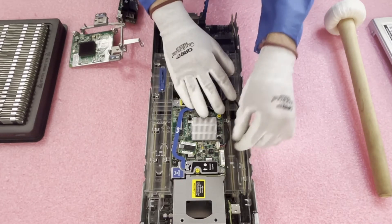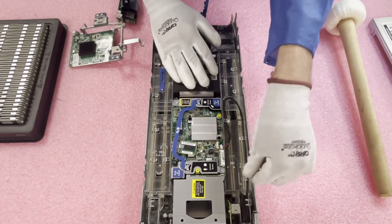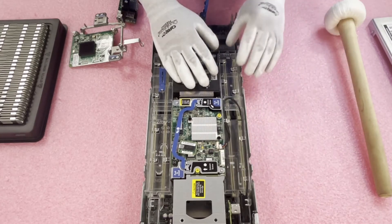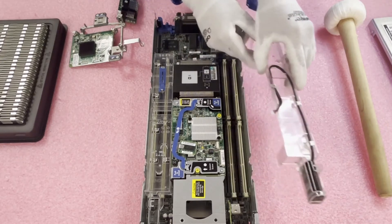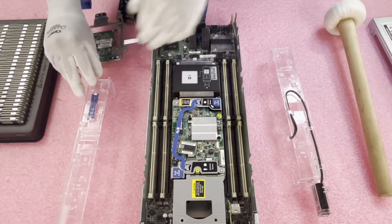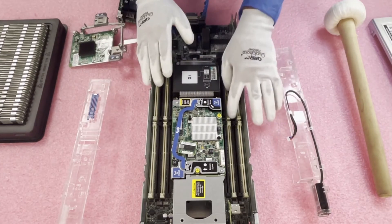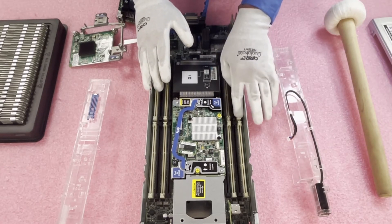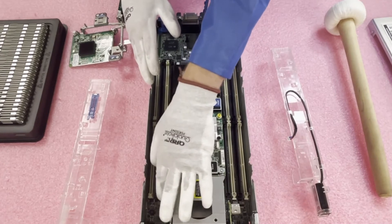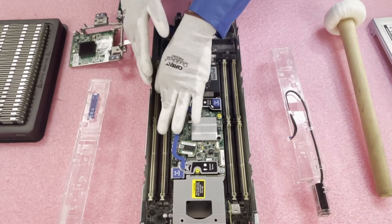Now I'm going to show you how to physically get in here. Take this connector and be gentle — you don't want to rip out any cords. Just loosely shake it and pull it out. Some people would prefer to do the wiring differently; to each their own. I personally like to do it this way as long as you can be safe with it. Now that I've removed the cable, you can simply pull the air baffle up on both sides and it just comes straight up. Now we're physically in and we can access everything. Before we load it up, one thing I personally always like to do that makes it easier is open all the tabs, making sure everything is completely open, so that when I'm in here holding a module, I'm not fumbling around trying to push a tab down and potentially drop a module and damage the motherboard or damage a module — just little things to make your life a little bit easier.